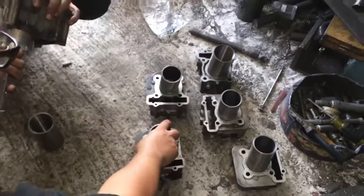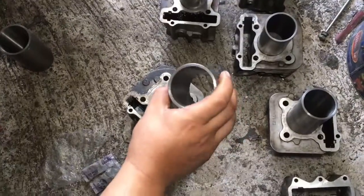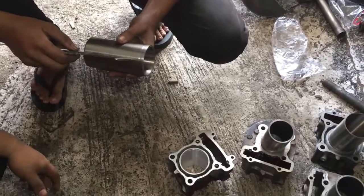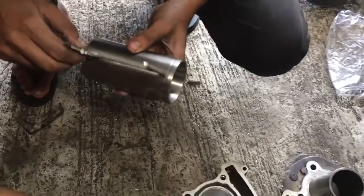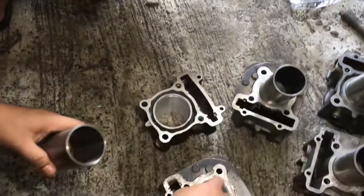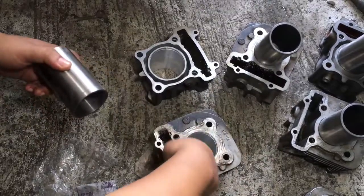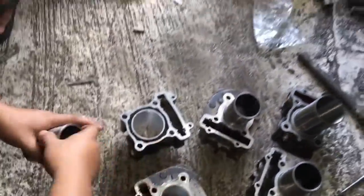Okay, my friends, this is the process — first enlarging the diameter for mounting the liner or boring. This stage is done. The next step is pressing the boring liner in. The lathe work must not be too loose and not too tight. If it's too small, the block can crack when pressed. If the liner is too loose, it can easily come off. Stage one is complete.